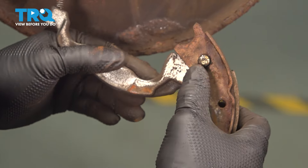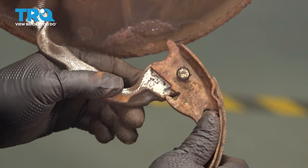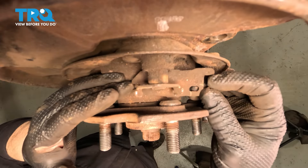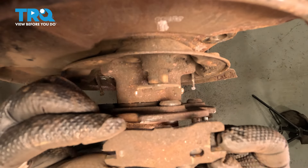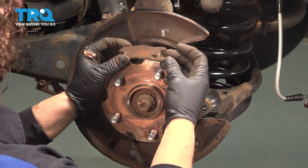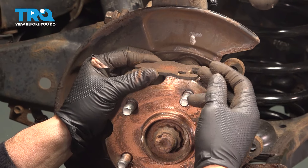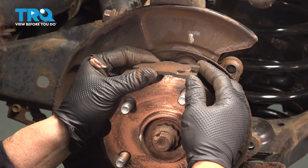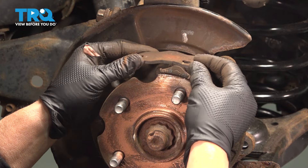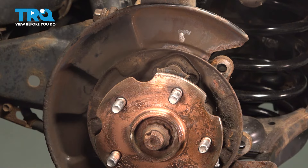On this particular make and model, there is not that typical horseshoe clip — there's nothing. You're just going to pull that off and clean it up after. You also want to take out and keep an eye on how this upper adjuster comes out. It's a spacer, and one side is wider than the other with one single slot. This is oriented for a particular reason: you want it on the rear shoe, facing the rear shoe and the hub. The cutout for the axle has that roundness to it. The wider opening goes to the rear. Set that aside.